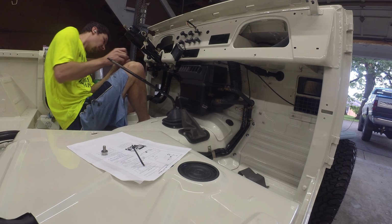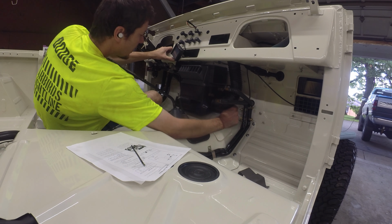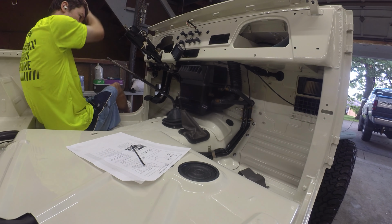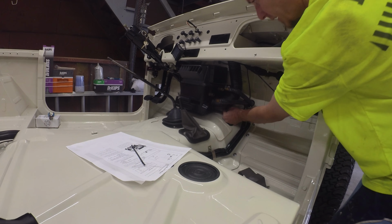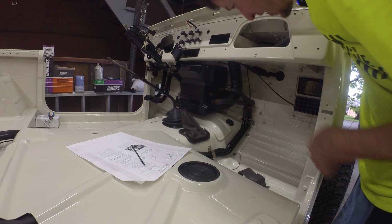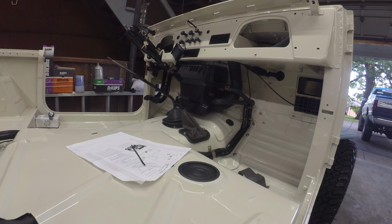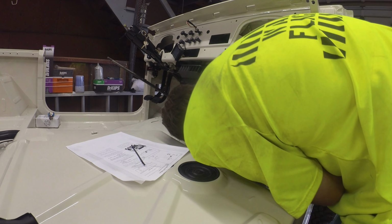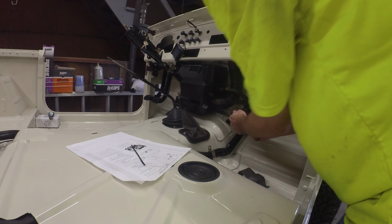I don't know that I'm gonna be that lucky on these bottom bolts. I have a suspicion they are made to be put in with those boots out. Basically, if this lower boot was softer, you would pop it out and have free access and then pop it in later. But it's a little bit aged. So I'm going to leave him in there and just reach behind it with a ratcheting box end, because I think we could get it. Yep.